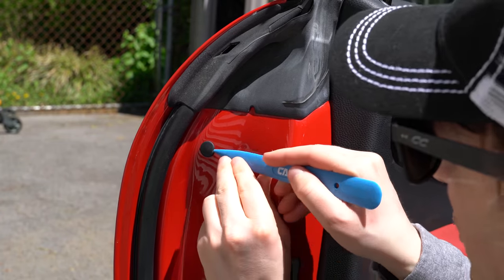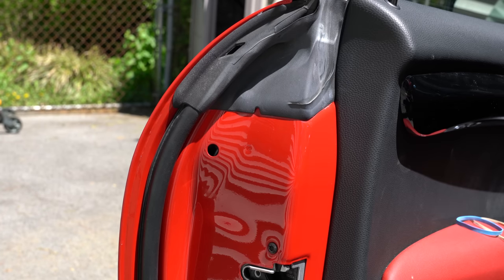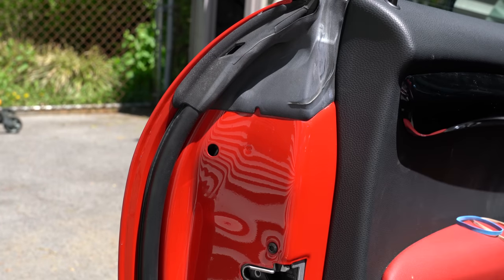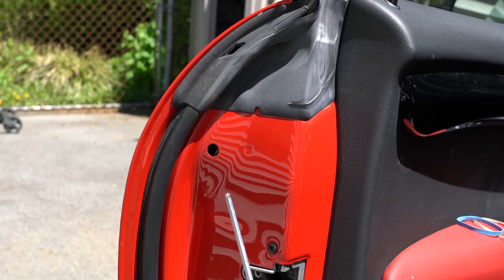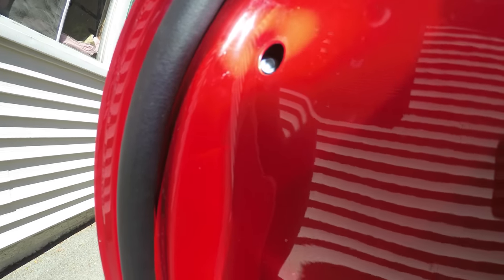To start, remove this little rubber gasket which covers a hole — and in there is a screw. I've read that the bolt isn't supposed to come all the way out, so you don't have to worry about dropping it into the door. However, on the passenger side mine came all the way out, so be really careful you don't drop it down into the door — that would make for a really bad day. In there you can see there's an allen bolt, so slowly back that out.